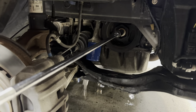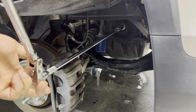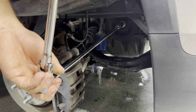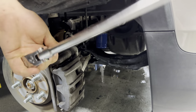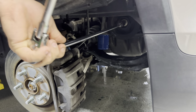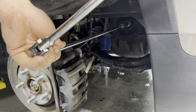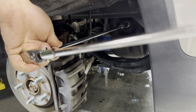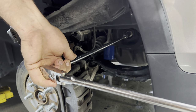All right, we're going to rotate our camshaft over to cylinder number four. I'm just going off of the crank bolt here. A side note: it makes it a lot easier to turn these engines if you pull the spark plugs out so you're not fighting the compression. That was the end of the compression stroke there, so we have to go back around one time. Now our cylinder one compression — and there's cylinder four.